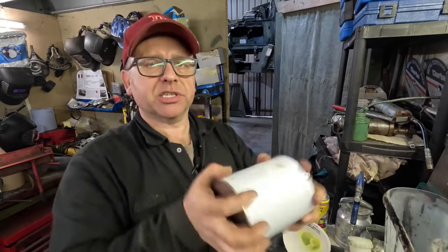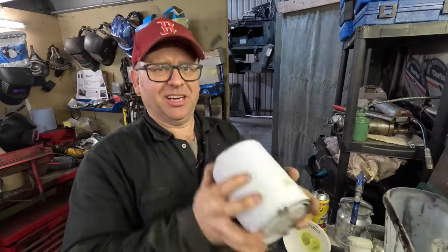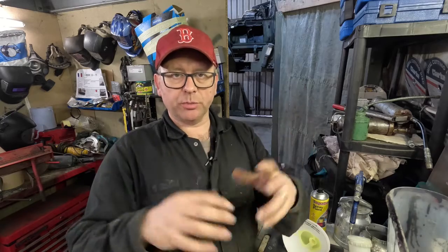So here we have the paint. It's nothing special, it's a cellulose chassis paint. We really want to shake it and stir it until our arms are falling out of our sockets, and we're going to mix it with an anti-bloom thinner. So there's two types of thinners. Well, in fact, there's probably a myriad of different thinners we can use, but two when we're looking at the cellulose. One is going to be what would be described as gun wash.